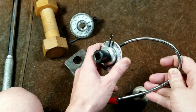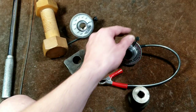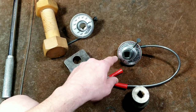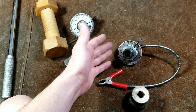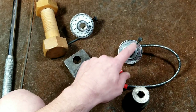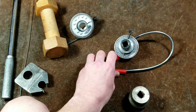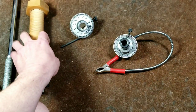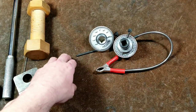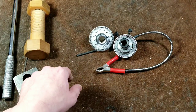This is really the style I'd recommend somebody get first, because it's going to be so much simpler and easier to use. You just get it set up. The last thing you do is just easily undo the thumb screw, set it to zero — or if zero isn't the easiest to see, you set it to 90 degrees, and then if you need to apply 90, you just torque it to 180 degrees, and so on. That's just a basic quick overview and review of a couple of different torque angle gauges. They're definitely very handy, quite useful, and many times absolutely necessary in your toolbox. Thank you so much for watching — please subscribe. Cadis Maximus out.